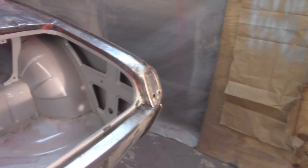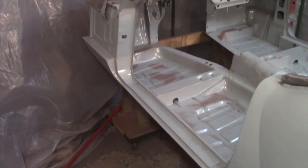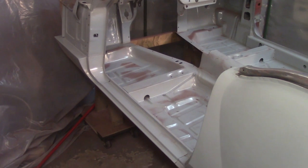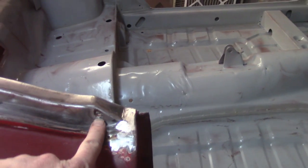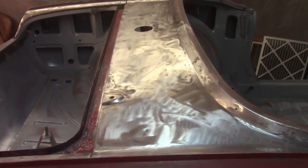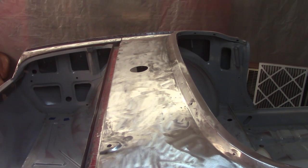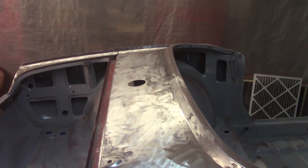And the weld repairs. So what I'm going to do right now is mix up some fiberglass and get the fiberglass on the spot welds and everything that have little pits in it, which, like I said, is most of them, and get that covered and get that curing so that if I get any overspray on it, it's not going to mess that up. And then I'm going to go on to the weld repairs with these holes here and try to fill this hole back in a little bit and get that back to a normal size. And then hopefully get into paint. It's 6:15 if I didn't mention that, so I've got about an hour and a half or so of work time left before I really need to get that first coat on, as far as being a school night and all.